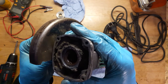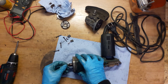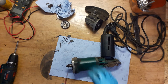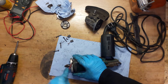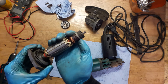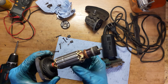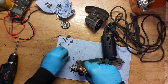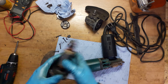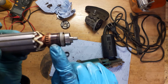You can inspect the gear from this hole. I will remove the armature — sometimes it goes easy, sometimes not. I'm using the screwdriver to make this easy. As you can see, this part is all spinning around, which is not very good — it makes some noise when the tool is working. The ball bearing is in almost good condition. As you can see from the commutator, it's well used.